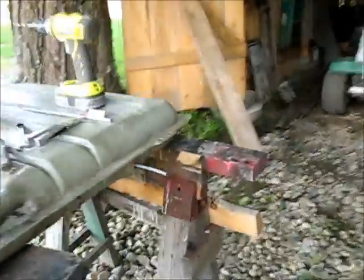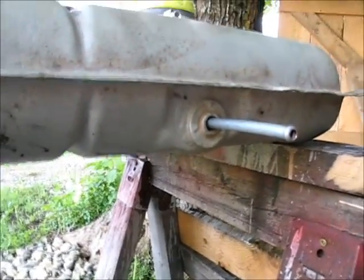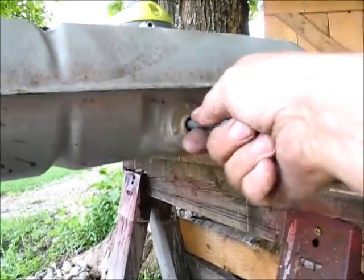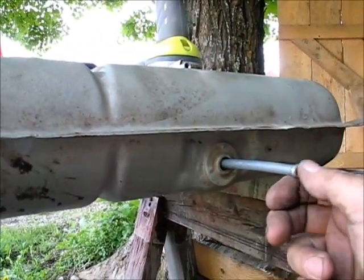I think I've come up with a solution for my fuel tank line that I like better than anything else so far. What happened with this thing is the old fuel line went in here. There was a piece of pipe in there that had gotten down in the bottom of the tank and it had gotten hopelessly stopped up. What I did was I took a drill and I drilled that out and I slid a new pipe in.